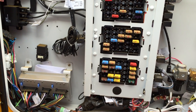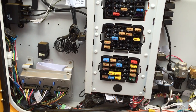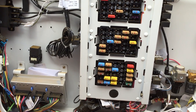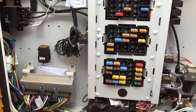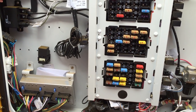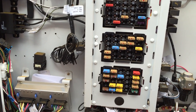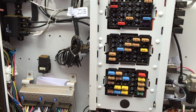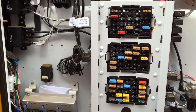If you're 45 minutes into a regeneration event, can you stop it? Yes — a regeneration will automatically stop if you hit the brakes or put the bus in gear. You'll hear the engine idle down right away, and then the next time you go through the same procedure, it will pick up from that point and complete the process.